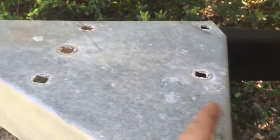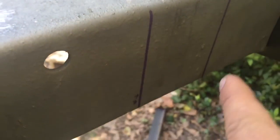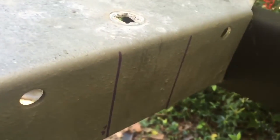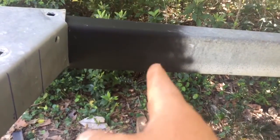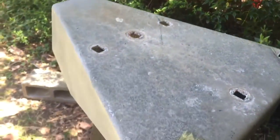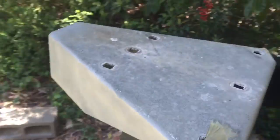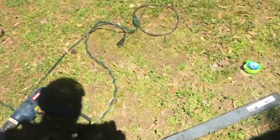For the tongue, since I have to pull it back further on the trailer, my 3/8 plate will be bolted back where I've got good metal. I measured the tongue so it would butt up to the inside of this cover piece, then measured to remove that in the back so the tongue slides out the rear of the cover and bolts up to my 3/8 bracket and angle iron. I might also use these holes to bolt my spare tire on, which would cover everything up and keep it looking neat.